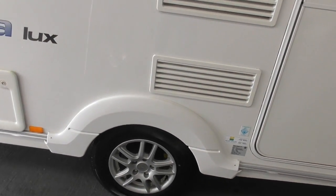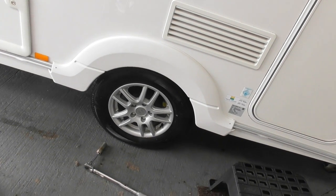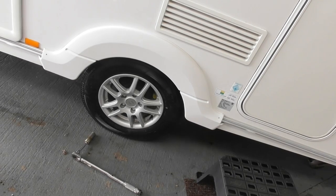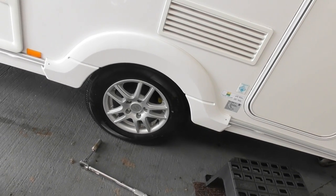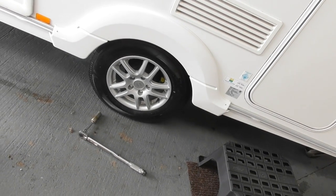Okay, this is very important. I've got my torque spanner there ready. That you do check your wheel nuts regularly. Okay, make sure they are tight. If you've got a torque spanner, obviously all the better. There's 115 Newton meters setting on the torque spanner. I will check this before you leave. Okay, but just make sure you are checking them regularly.